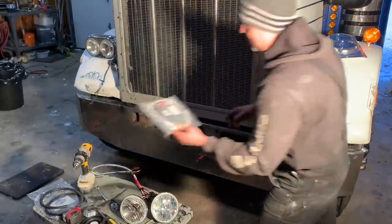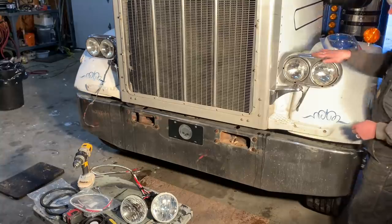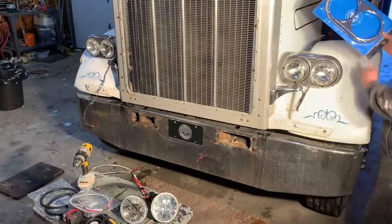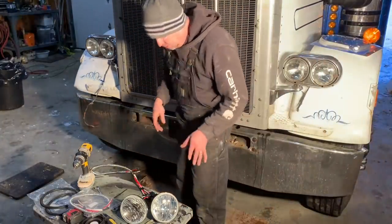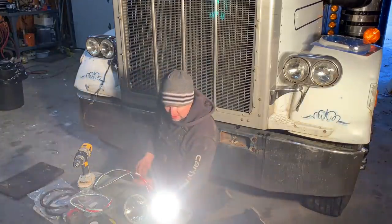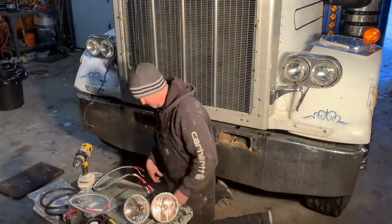Obviously got to put on these nice chrome wire looms that mount and click to the bulbs, then run through the hood and get wired in. The guys at the polish shop mentioned they did the best they could - this is the original chrome ring but it's just been hit with rocks through the years - so I ended up getting new headlight bezels. The outers are the low beams with three wires. The high beams have both bulbs going. One circuit is the outer for your low beam, and the other circuit - the red wire - lights them both up. That's how the low and high beam works.